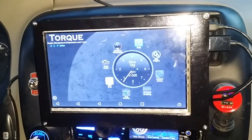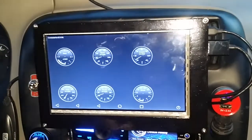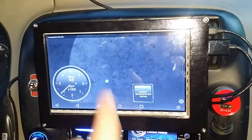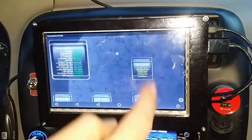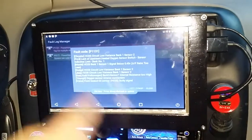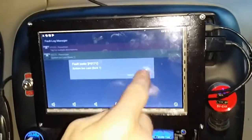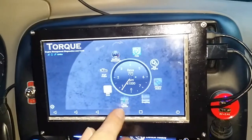We have real-time gauges and information — I don't have the sizes set right on them right now. But you also have other individualized custom screens for other gauges. You can do quarter-mile times and see all kinds of different engine system information. You can check your fault codes — I have a bad O2 sensor right now. Upstream heated oxygen sensor switch is bad, and it's running lean because of that bad O2 sensor. All of this information comes from Torque.